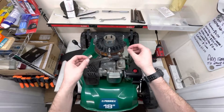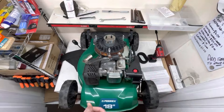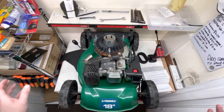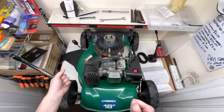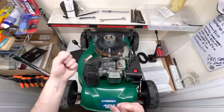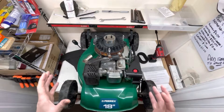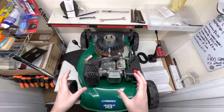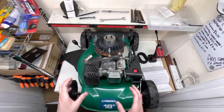If you were at top dead center, the piston could go either way and the blade could swing back — with a lot of pressure in there it can be extremely violent. We don't want the blade spinning and losing fingers. So two things to negate it: first, go just past or just before top dead center and lock it in the direction it would travel; second, only apply a small amount of air. Sometimes people apply 100 psi because it's a round number, but it's too much, it's not necessary, and it can be quite violent if something goes wrong.